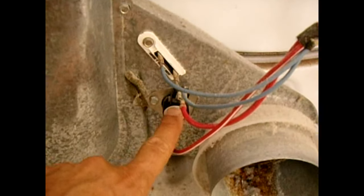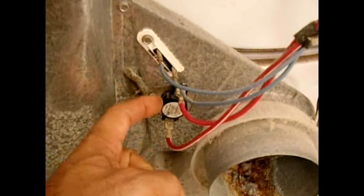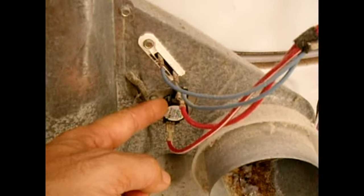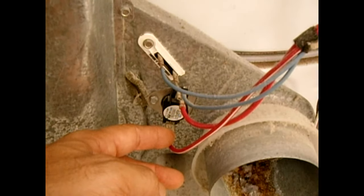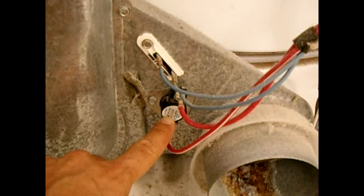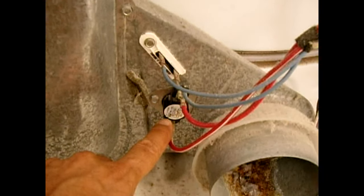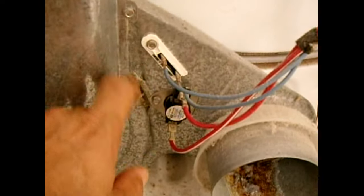You can also remove the thermostat and apply a heat gun or hair dryer close to the metal disc on the opposite side. With your continuity tester attached, you should have continuity at room temperature, then hear a click and the alarm should go off as it heats up to its trip point. Let it cool off and it should come back on again. However, this test won't confirm whether the temperature rating is still accurate — a faulty thermostat could trip at 180°F instead of 150°F, causing the thermal fuse to blow.